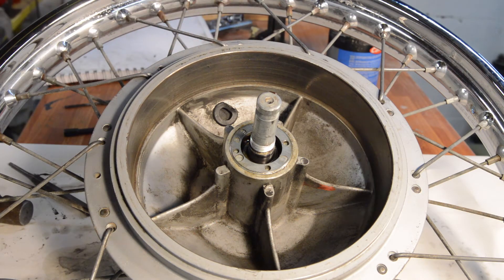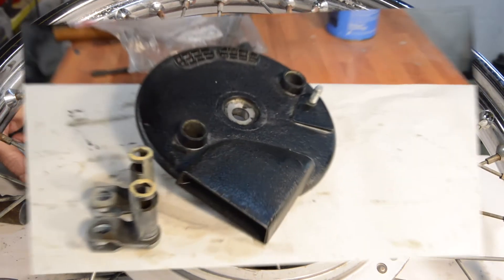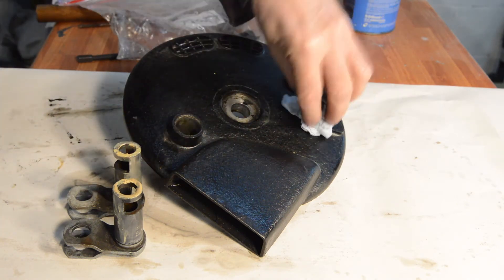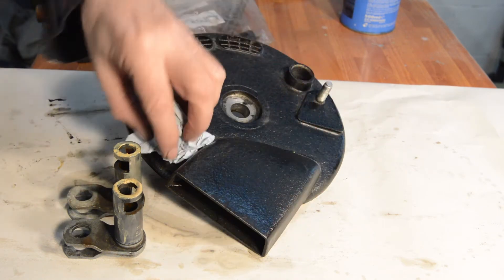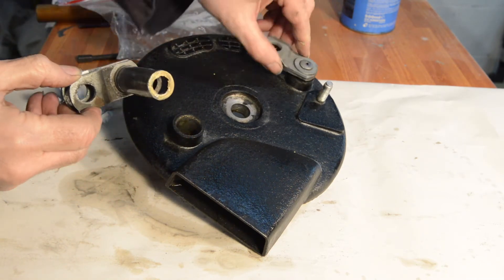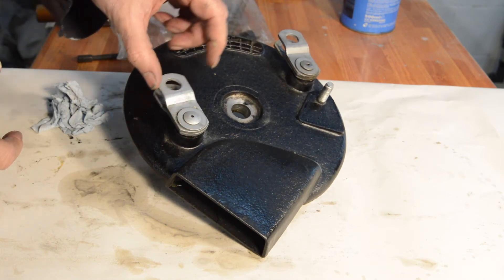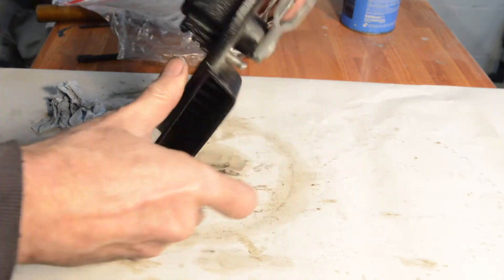Right, I'll tap that back round into place and we'll rebuild the brakes. We have our touched-in front brake plate in crinkle black, which is a bit dusty because it's been sitting on the shelf for some time. We have our two arms with some anti-seize compound on, which allows them to move freely but won't leak into the brake, I hope.